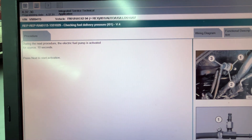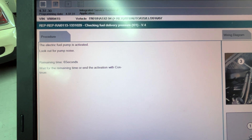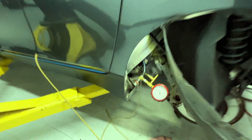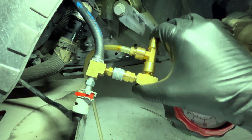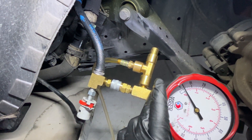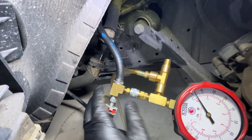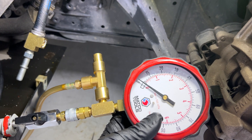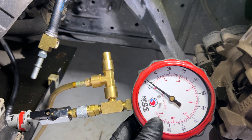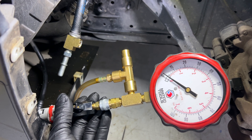The test plan is going to activate the fuel pump for 10 seconds. We might have to do it a couple of times because there is air in the line. Fuel pump is activated — looking for pump noise. Right now there's no fuel pressure. I'll purge the air out and run the test again. I activated it again but I'm not getting any pressure here — I can hear the pump turning on, but there's no pressure. Maybe it's going through the bypass. I'm going to tap directly to the source from the pump — and there's still no pressure coming out.